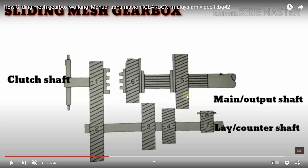When we need to change gear, we apply the clutch so that the clutch shaft is disengaged and stops rotating. Then gear number five is slid to the left-hand side to engage with gear number four. All the gears used in a sliding mesh gearbox are spur gears so that we can slide one gear over the other — if it were a helical gear or any other type, we could not easily slide one gear over the other. That is why spur gears are used in the sliding mesh gearbox.